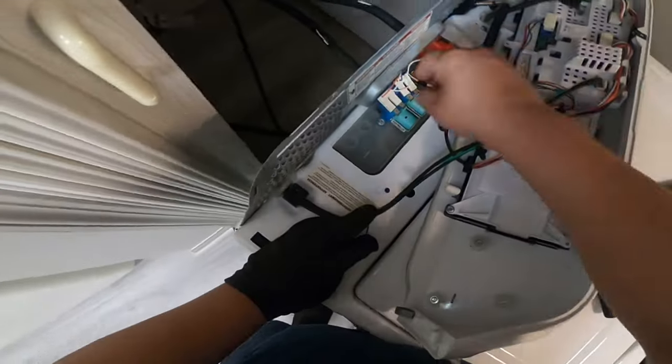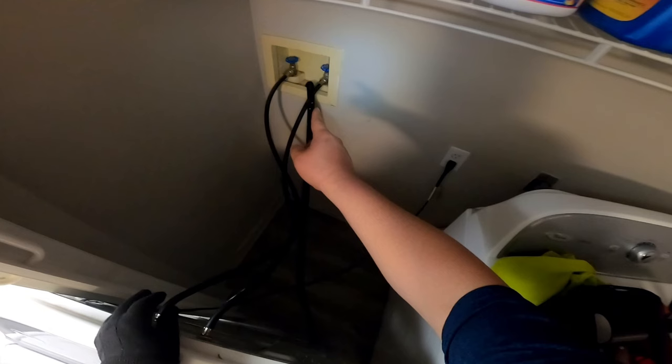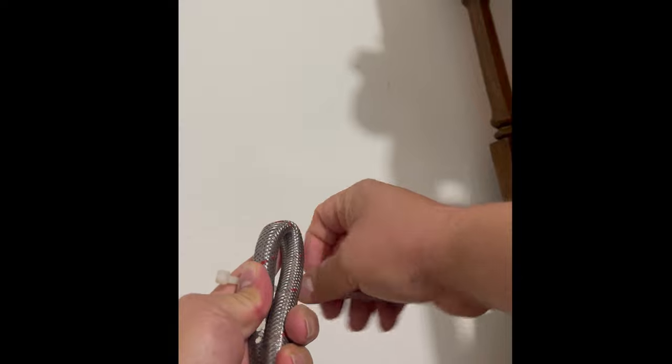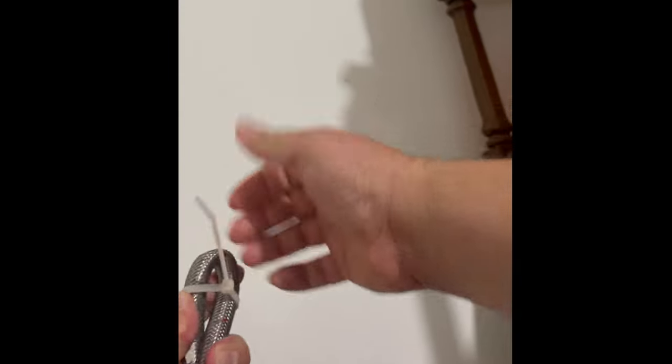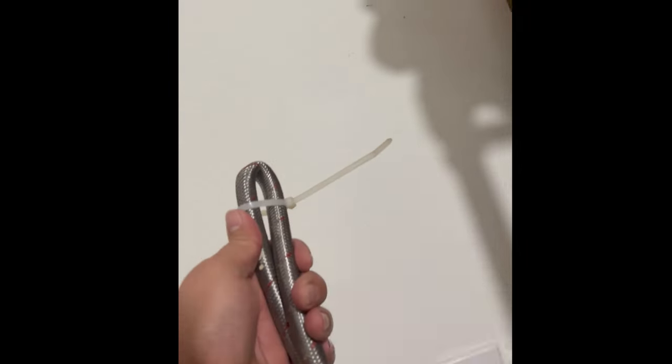Just to be on the safe side, we're going to replace both valves, because I've been in a situation where I replaced one and after a day or two the other one started leaking. I'll put a link in the description so you can buy both water valves as a set. Remember to turn off the water before you disconnect the hoses — or kink the hose if your house water valves aren't working right. If necessary, shut off the water for the whole house to prevent a flood.